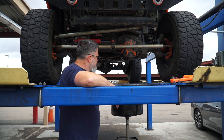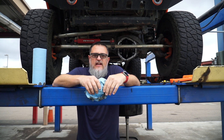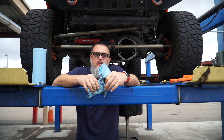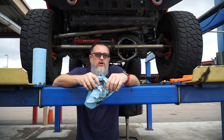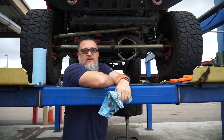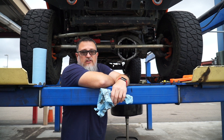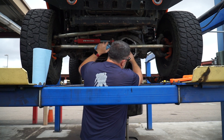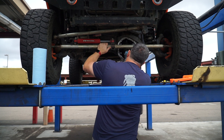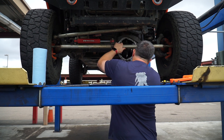I just want to make sure there are no chips or anything. We have the oil out of there and I was going to clean it out with brake cleaner because I was concerned there may be some chipping. Everything in there looks really good — I wiped out some of the grease and put it in my hand and there are no metal chips or anything like that. So we're just going to put the cap back on it and refill it because it looks absolutely perfect. I was concerned because of the leaking, and I didn't know how long it had been leaking when I noticed it. The gears look great, locker looks good. We're looking at the teeth to see if any chipping is present — there is not. No real signs of wear or anything like that. The locker looks good and everything seems to be working appropriately.